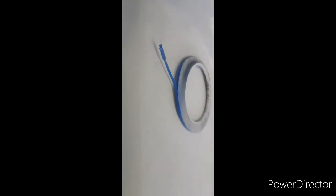So with fine line, you get two different types. I probably did it in the helmet video, but this is a more flexible fine line, 3M, so you can do curves and stuff like that. The one I'm using on this is a hard line, so you get straighter lines. Don't try and use that blue stuff. You just end up spending ages trying to smash your fine line out. But yeah, I'll show laying this down. It'll be in fast mode because it'll take up so much space for this video, and because after this I want to lay colour and have some footage for that. So here we go.